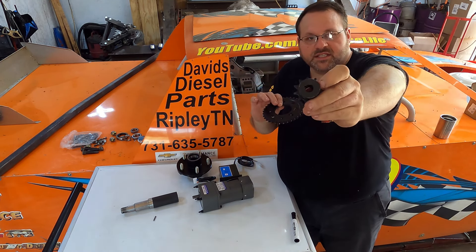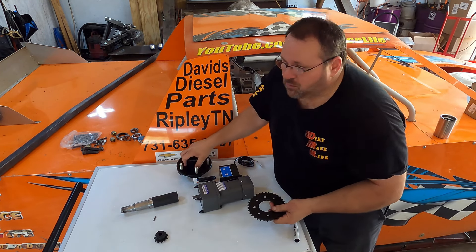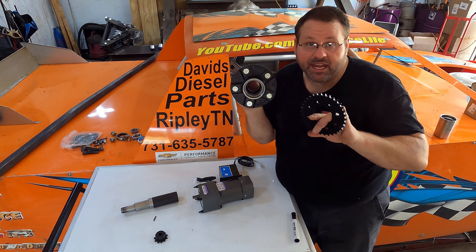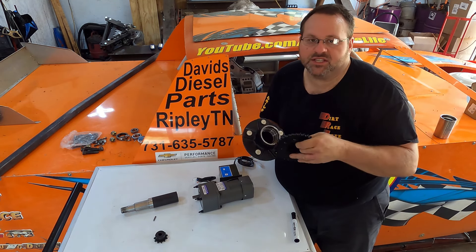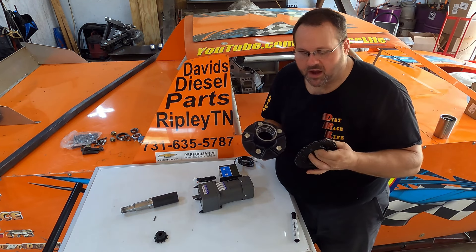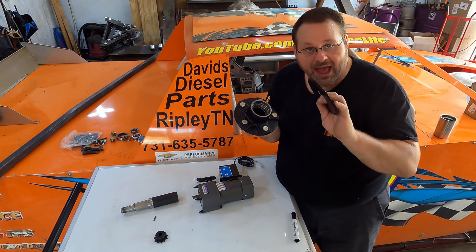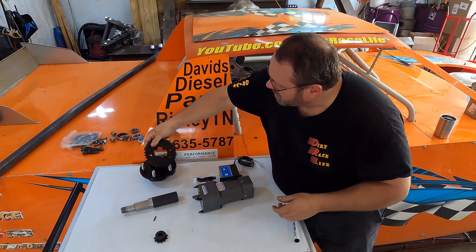The other parts are the sprockets — number 40 chain sprockets. This is the drive hub, I think an 11-tooth, and maybe a 39-tooth. I'll put the exact specs on my website. Probably the most challenging part of this build — especially doing it at home with garage tools versus machinist tools — is attaching the sprocket to this hub in a way that you can take it on and off and that it's in the right location. In the past I've welded this stuff up, but then if you need to change the ratio you have no options. You need to make sure you've got a plan for how to line up the chain.